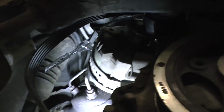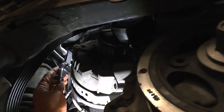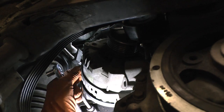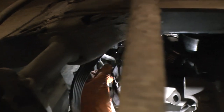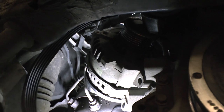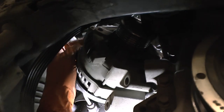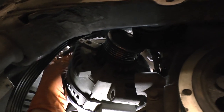That's the alternator from under the wheel arch. There's a 10mm nut — I think that's the earth cable I'm undoing. There's a nut and washer that just has to come off. Very hard to see up there — I'll just pop them off. That earth cable should now just lift off. Yeah, that's now off. There's another 10mm right at the very top of the alternator screwed in as well.